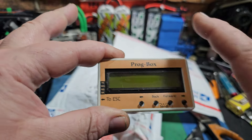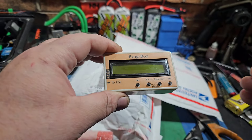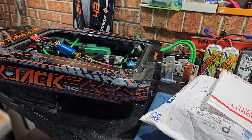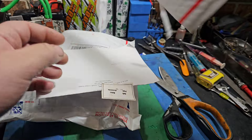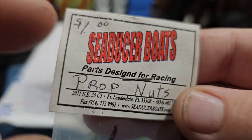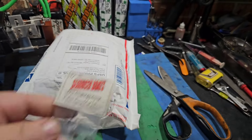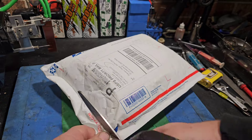All I really needed to do was go down on my timing. I knew the timing was set high on that ESC but I ran it anyway. We actually got about 92 miles an hour with terrible timing, so I'm pretty stoked about that. I went ahead and ordered some prop nuts from Seaducer Boats — he has hardware, props, electronics, all in-house. And this is my rotor from TP Power.